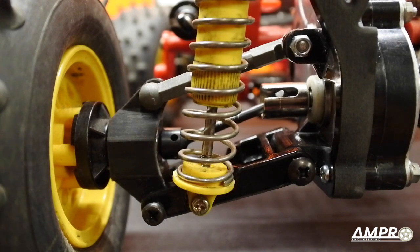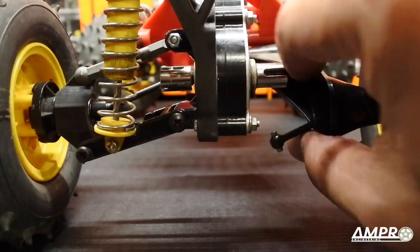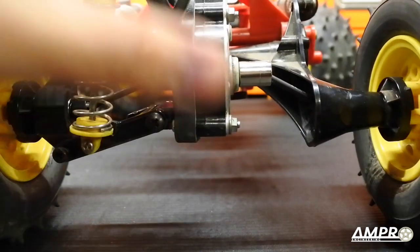In this case I am using a tie rod, but I feel the production version should be a rigid upper link, because this is not really a race car — it's a Blackfoot, it's an ORV. Like the Super Blackfoot and the King Blackfoot, those didn't have adjustable upper links. That said, a rigid link will also increase the price because of the higher-priced 3D printing. Maybe you guys can give me some feedback — I'm thinking I might just stick with the turnbuckle because it's going to be cheaper.